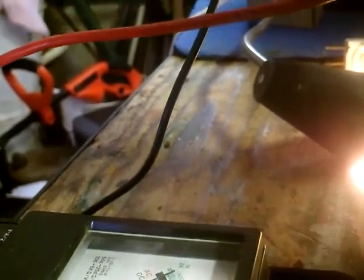Let's go down to 10 volt scale. You got 3 volts. That's negative, that's positive. 3 volts. You're supposed to have 12. Yeah, but if you do it for a day, 2 days, it'll be 12. I think so. Well, if the battery's any good, yeah. But without a load on it, see, this meter doesn't put a load. We still should be reading at least 10 volts.